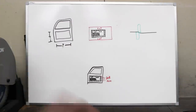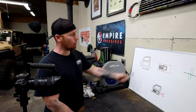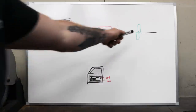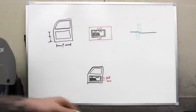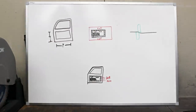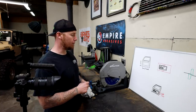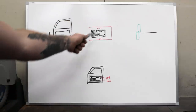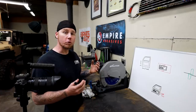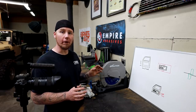After I've made the design and decided it's something I can do and it's going to look good, I'll take it to the bead roller. For those of you new to the channel, a bead roller is basically a couple of different shaped dies — you put material in it, squeeze it down, and you can step up or step down your material to create really amazing designs. Then once done, I'll trim away any excess and pick where to drill. I'm going to use rivnuts with quarter-inch stainless steel button head hardware for a really nice finish.